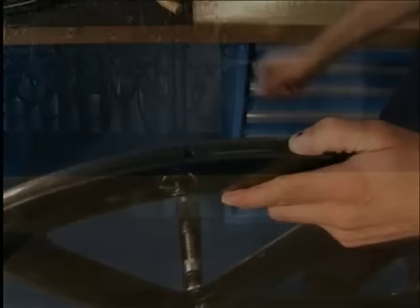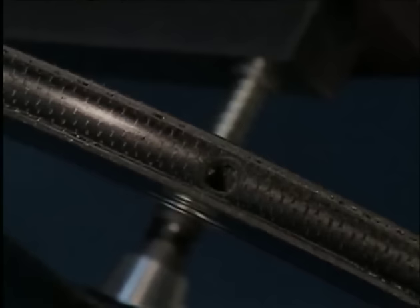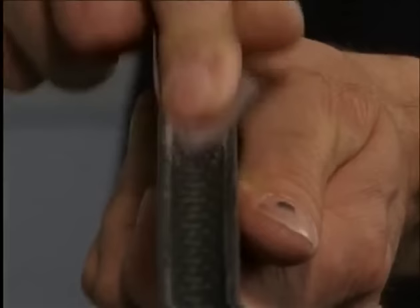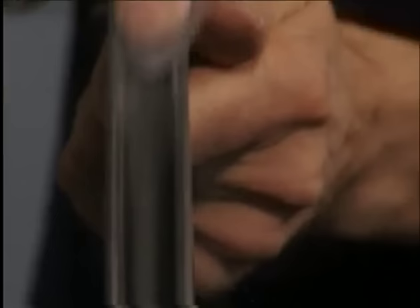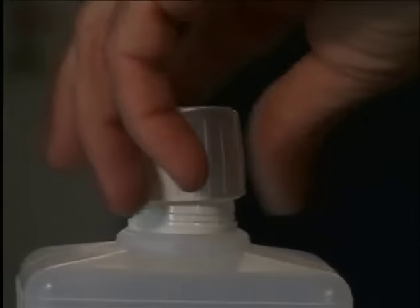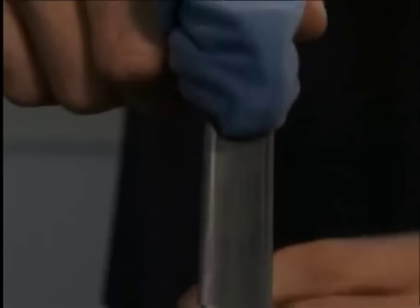On carbon rims, the valve hole is slightly countersunk with a scraper, so that the tire lies flat at this spot. The rim bed is sanded intensively with the abrasive cloth. The rim bed must be cleaned and degreased with solvent. Carbon surfaces have a greasy character, therefore the cleaning must be done carefully.